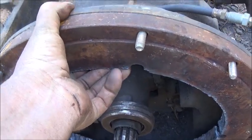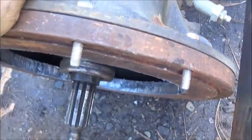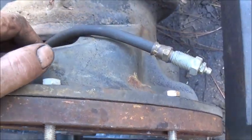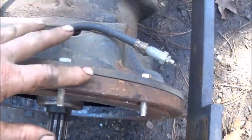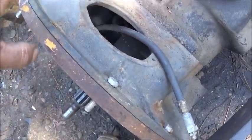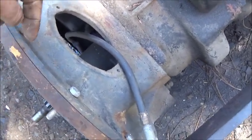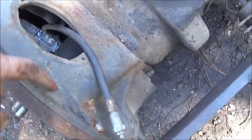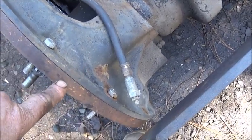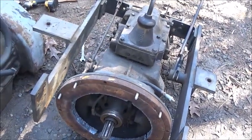Of course you can see it moves now. The plan is to get the transmission in — it's going to line up on the engine but it won't be solid on the transmission side. So the plan is to get it where I want it, tighten it down good and tight, and then drill it in probably three or four places and put dowel pins in through the bell housing into the adapter.